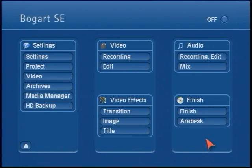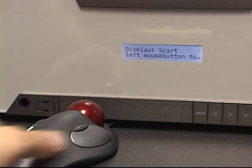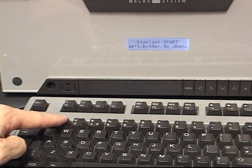The emergency screen switch function can also be used in Media Manager as well. This would be useful in cases where you switch from Bogart and go into Media Manager, and suddenly the system's screen goes to black. In most cases this means Media Manager is resting on the main menu and has been set to a completely different monitor mode than you're using on Bogart. The same thing as before — hold the large right trackball button down for six to seven seconds, and you'll see a message on the front LED screen to indicate it's in display mode. Use your keyboard's number keys to switch to the appropriate screen display.